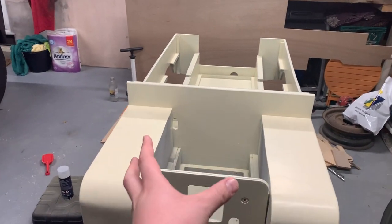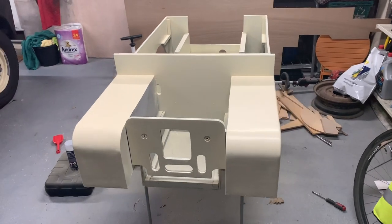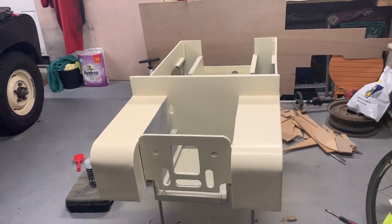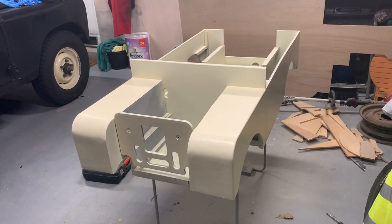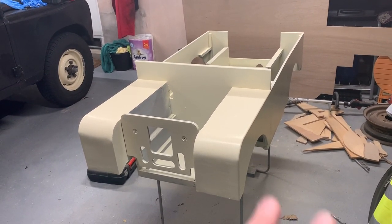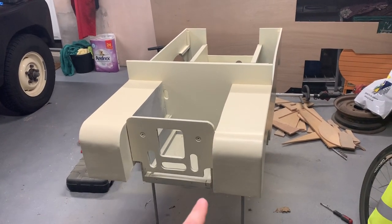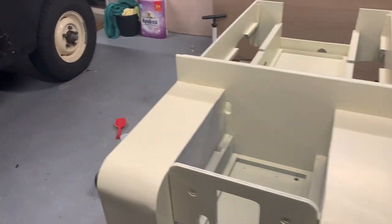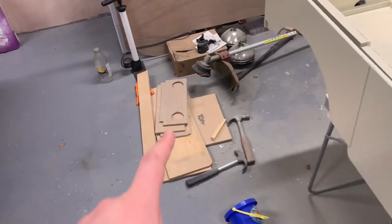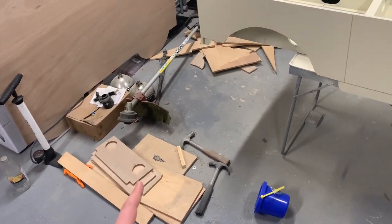To finish the inside and tidy up the engine bay I'm going to have to put the whole thing up on its side, put a sheet down to protect the bodywork already done, then rub everything down with very fine sandpaper — probably 250 to 500 grit — and then lacquer it. There are quite a few steps to go, and I've gotten a bit ahead of myself because some panels still need PVA glue, priming, and colour coating.